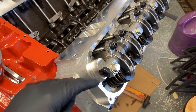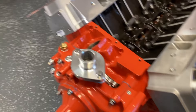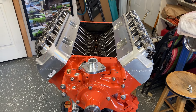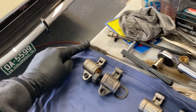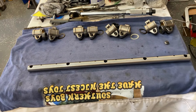I still need to yank these off one more time, clean up the rockers, and clean out the shafts. I want to show you what's inside these shafts. The other side looked like the inside of an old chimney, so I'm a lot more pleased with this one. Notice they do have the oil holes offset, and they tell you in the directions how to orient those. I'm going to take my Goodson brush, run through here with a little piece of t-shirt and some brake cleaner, run it in and out three or four times, and finally be able to reassemble this.